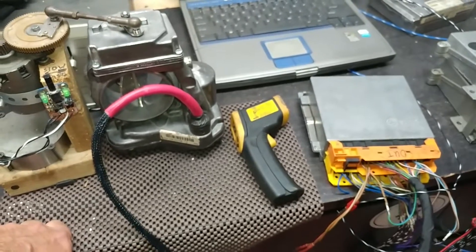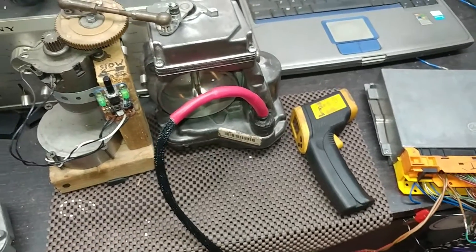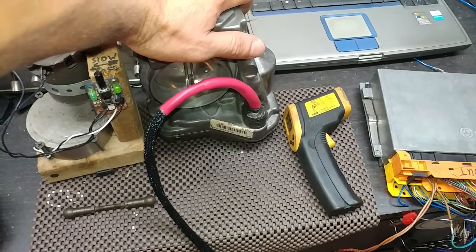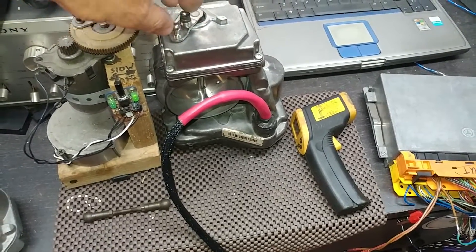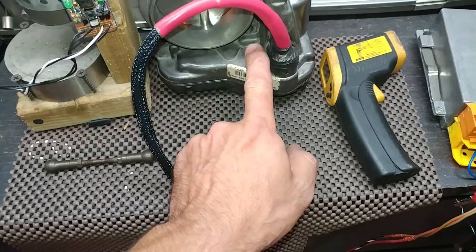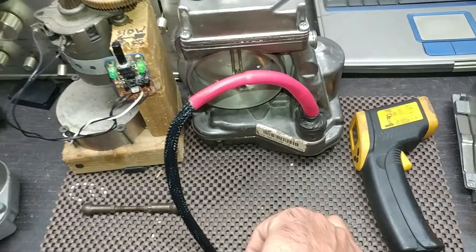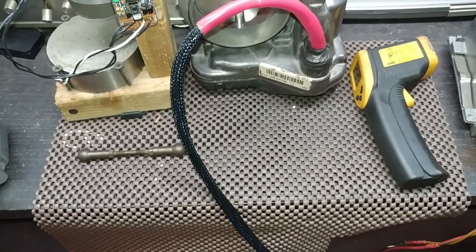The test has been successful — I don't see a problem anymore with either the E-gas or the throttle body. What happened is this throttle came in and it was rewired at some point. The rewire job wasn't great — the wires were poorly soldered, the board looked like it had been exposed to too much heat. They used a very hot soldering iron and the main connector was not inserted all the way, so when I took the connector apart the wires were bare inside, which is obviously a bad situation.